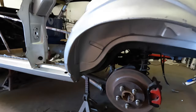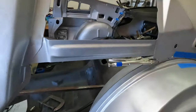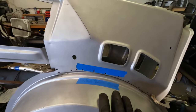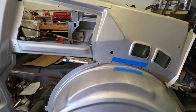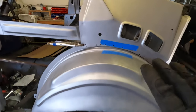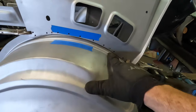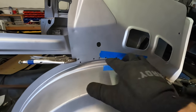What we're going to do now is separate it from the inner wheel well — we don't need that anymore, that was just to help mock everything up. This tape here was to remind me to weld before the quarter panels are installed. Basically I put the quarter panels on the car, then took the screws off that were originally on there, let it drop down so this lip would rest inside the quarter panel lip so when I weld them together they're nice and tight.